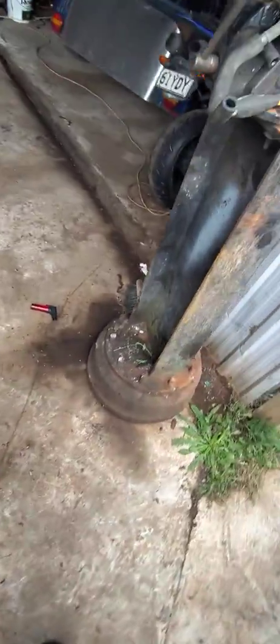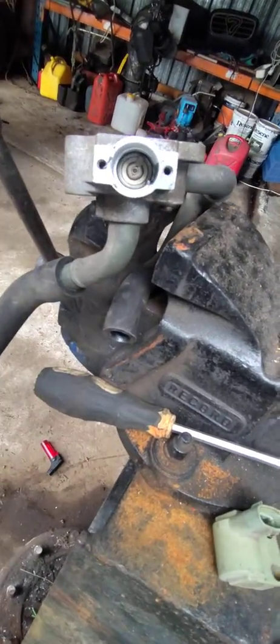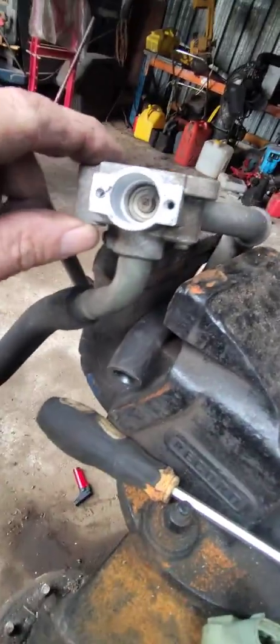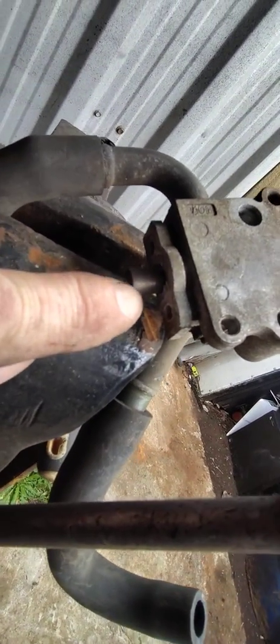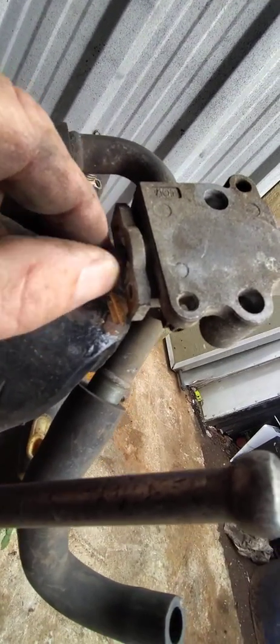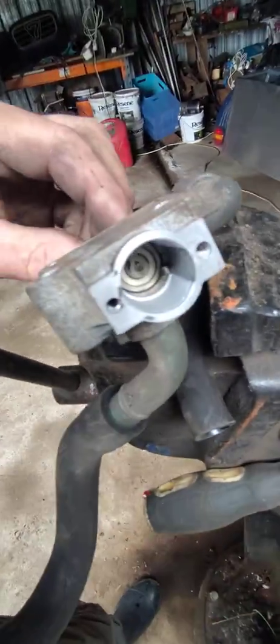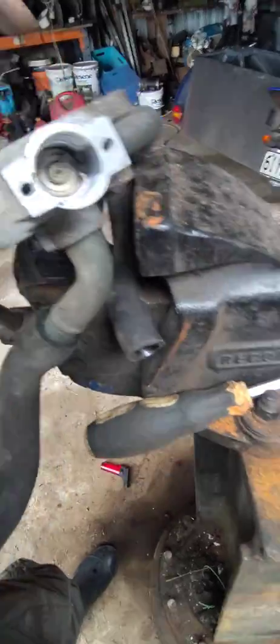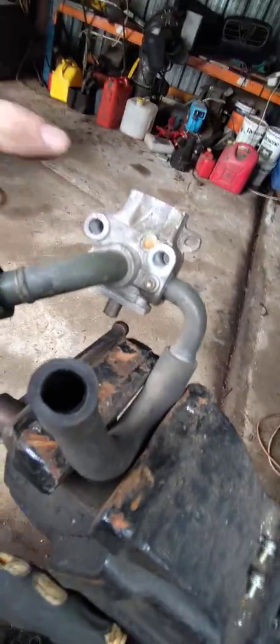The real fix to the problem though is to take a few minutes, undo the bolts holding your ISC device onto the vehicle, and take both ends off. Do not smash this end — it's not steel, it's ceramic. Work it back and forward with lots of CRC until the bearings come free, then start putting it all back together.